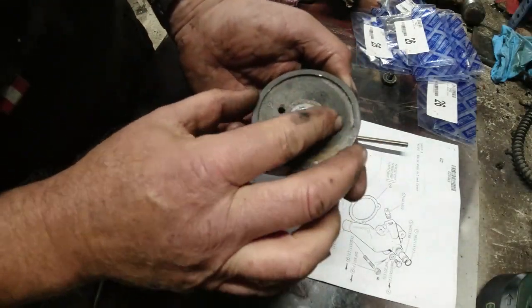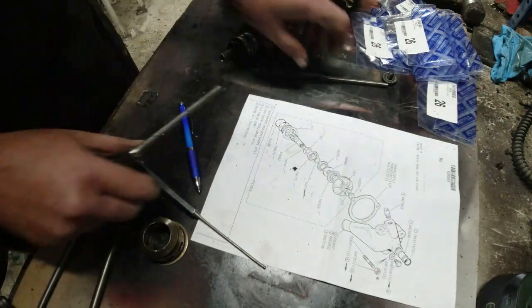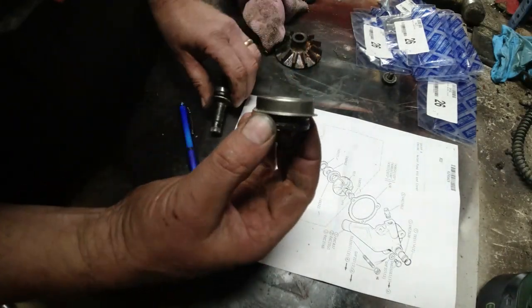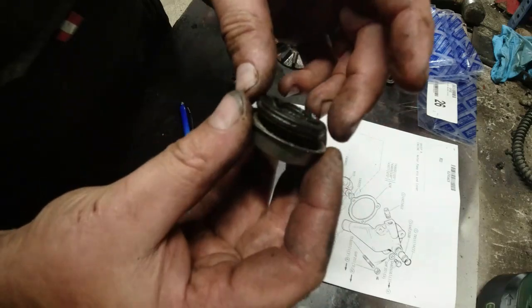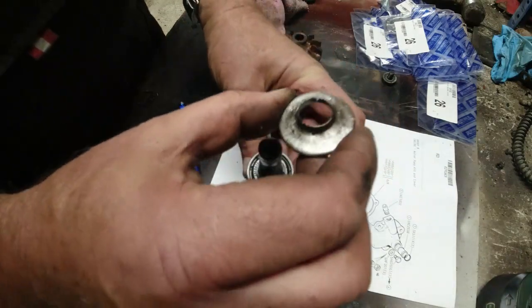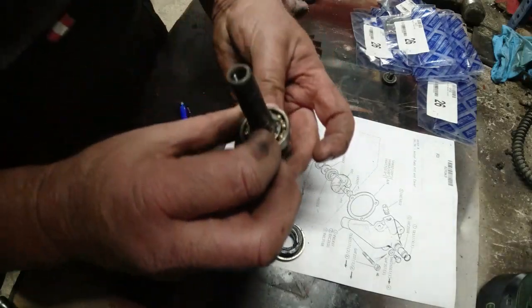The face that the seal rides on is all right, the top face is okay. Taking the shaft and the smaller parts — we've got the main seal at the top and that is looking particularly chewed up. It's probably a good job we were changing this. Then we've got the upside-down cup — this is obviously a refurbished water pump rather than a new one. Then we've got the seal, and then the bearing which is held in place with a circlip.